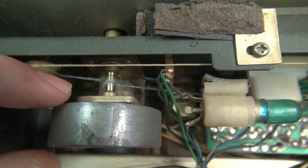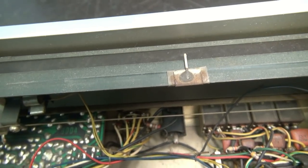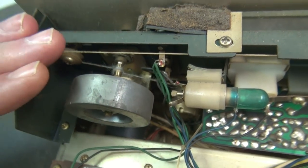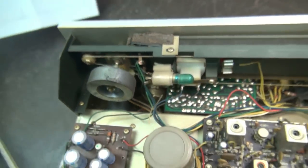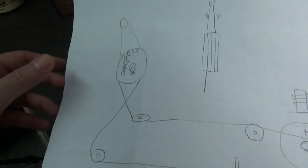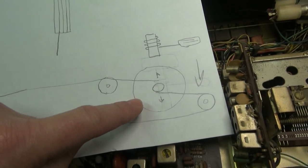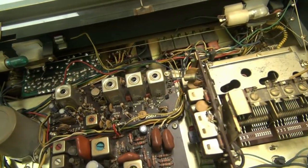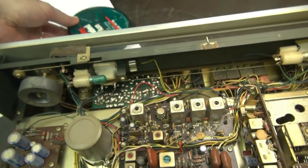There's a lot of shrapnel laying under it — it's just worn out. If you try to turn this, no needle movement. She's slipping really bad, but I don't want to interrupt this because I don't want it to break. So while it was intact, I made this fine sketch so I know how many turns were around the main pulley, how many turns are on the flywheel. Hopefully with that information and my trusty dial cord, which is the right size for this job, we'll be able to replace it.